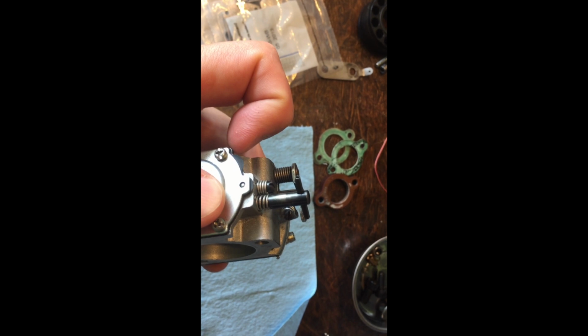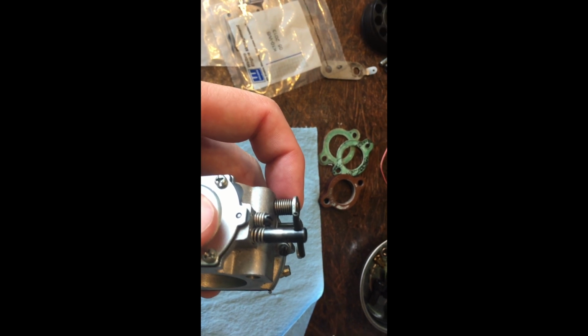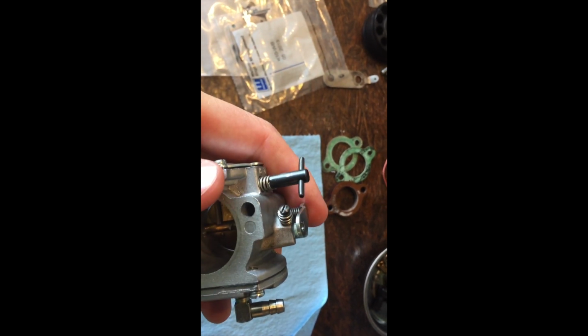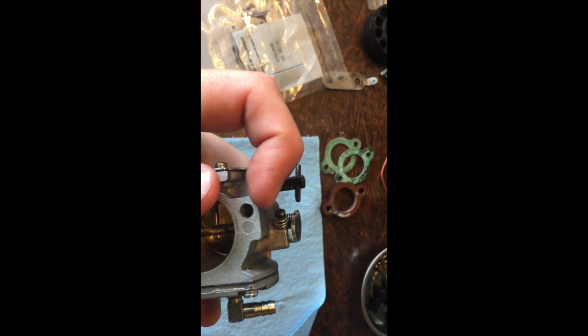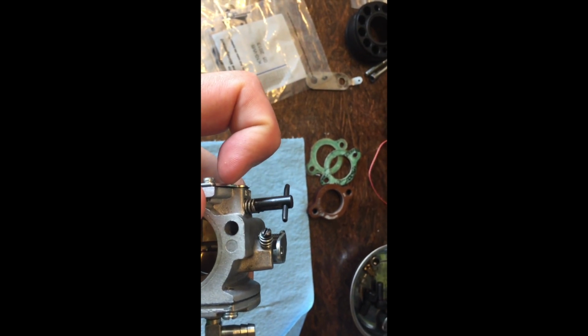And then obviously there's a manufacturer spec on all of these. If it's the first time you've rebuilt the engine, I would just put it back exactly where it was. You may want to richen the high jet just a little bit for break-in. And then this is your idle set screw right here. So if you put it back to factory settings, maybe make the high jet a little rich just for break-in. You can bump up the idle screw a little bit.